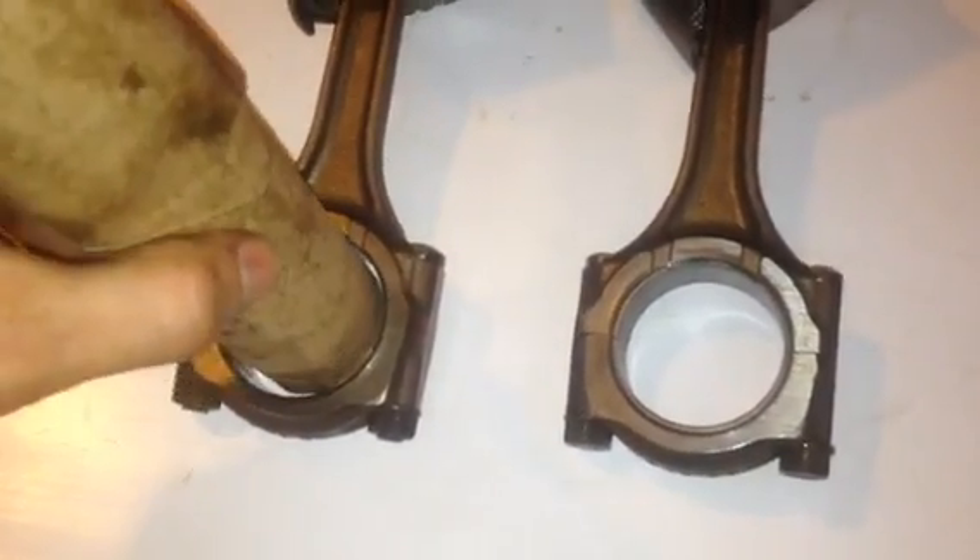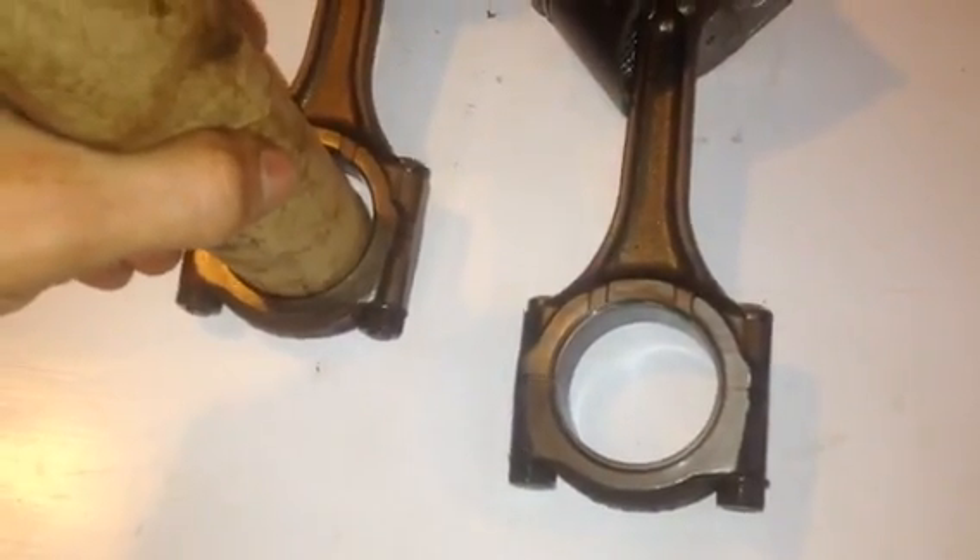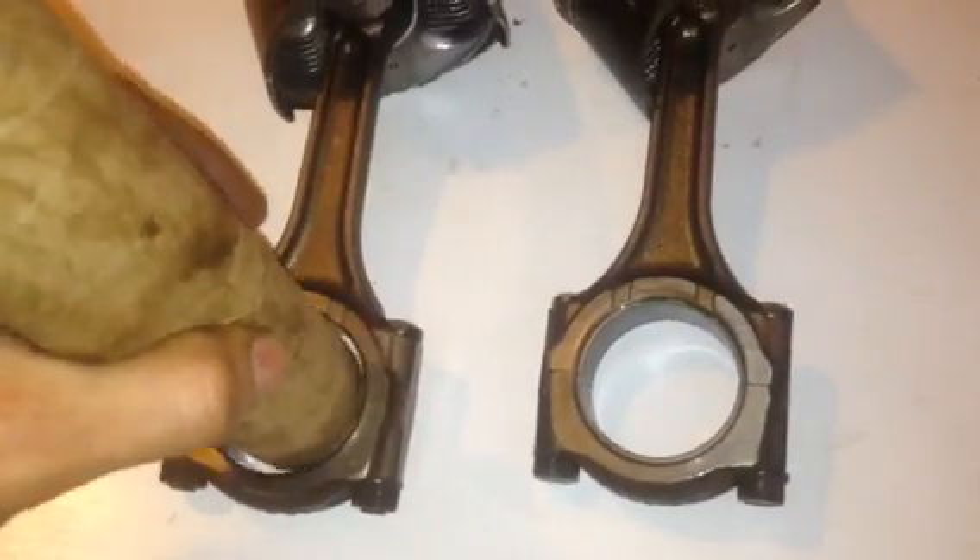When I move it over to this side, it has a lot of play in it. So when I lift up, it doesn't move the rod — now it moves it. It has the play, it comes back down. And that's going to be the knocking in the engine.